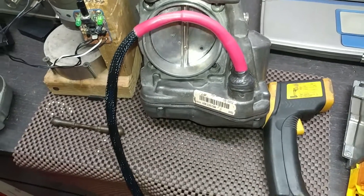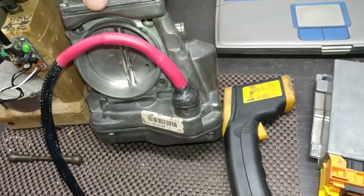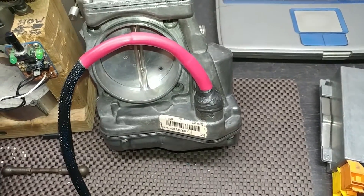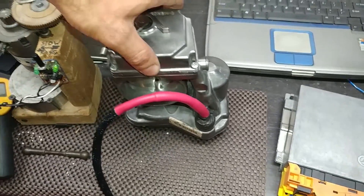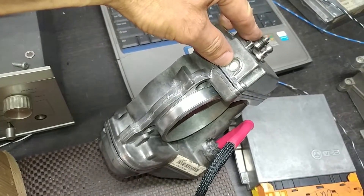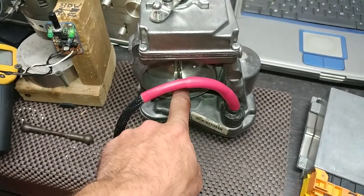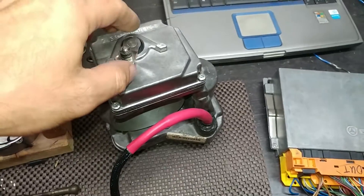Luckily I didn't have to change the board — I reused the original board and the rheostat looks good, which is a good thing. I siliconed the actual covers just in case, though I don't normally do that since there's usually no significant need. I'm not sure about the climate there, so if it's too moist it might help. When the throttle runs on the car it gets hot and everything vaporizes. There's also a vent here — moisture can get in and get out, mostly get out. The throttle is not a totally sealed unit.